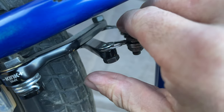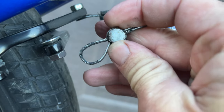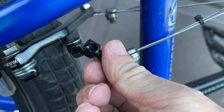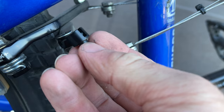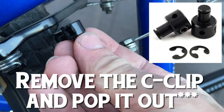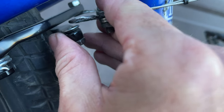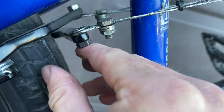It's so perfectly locked in, almost like it was made for that. The length of the bolt was perfect, and I feel like this setup is almost better than anything I could have done — I can probably do this with one hand. This loop just pops off the bolt no differently than the cable end would come out of the standard piece, and it's actually easier than the dual lower gyro cable piece, because with that you'd have to rotate it and pop it out or loosen the screw.